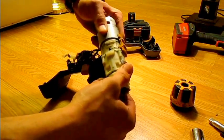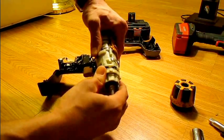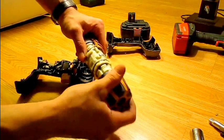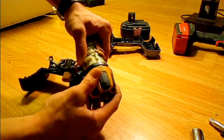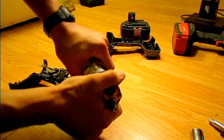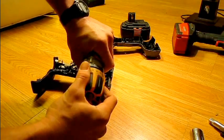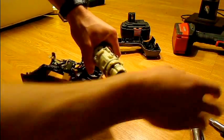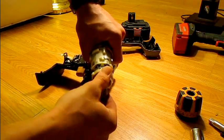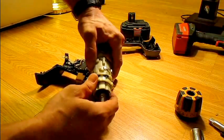And this is the torque selector. When you turn the torque adjuster on a drill and hear that clicking, all you're doing basically is loosening up some ball bearings on a spring set in there, and we'll see that more closely as we tear into it.